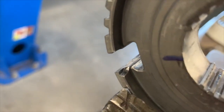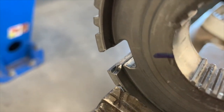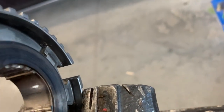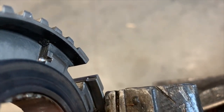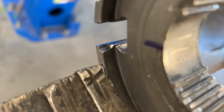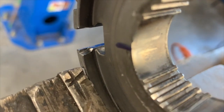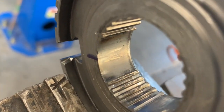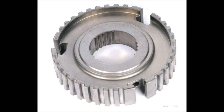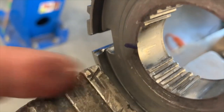What I found is that the inside is pretty worn out, but it looks like it's from the factory, because the other side — the 3rd gear side — also has one, but it's a nice square machined edge, whereas this one is not. They do not make this part anymore; it's discontinued. All the ACDelco pictures show this piece as straight across with no filing whatsoever.